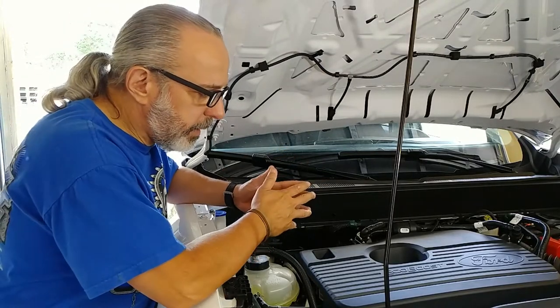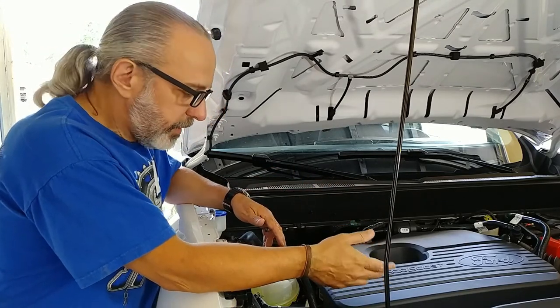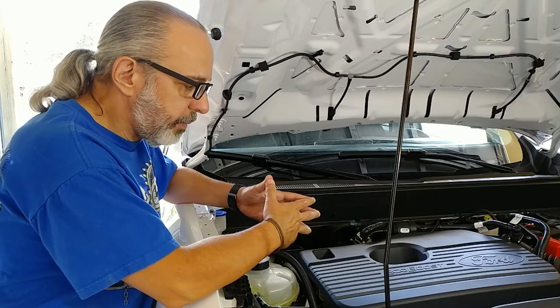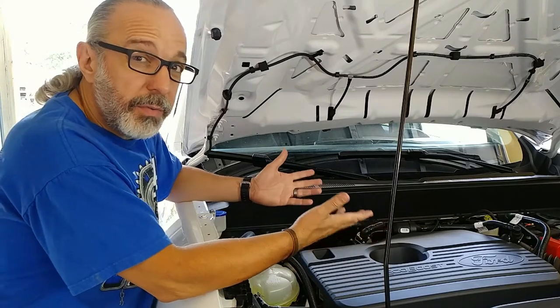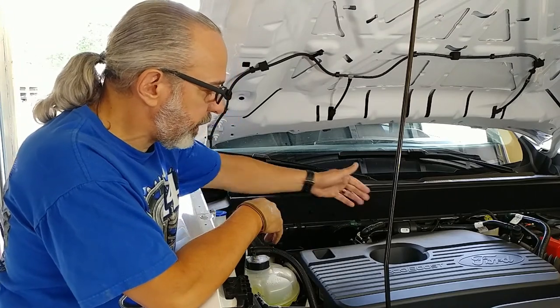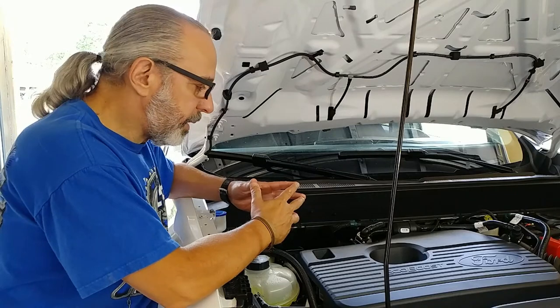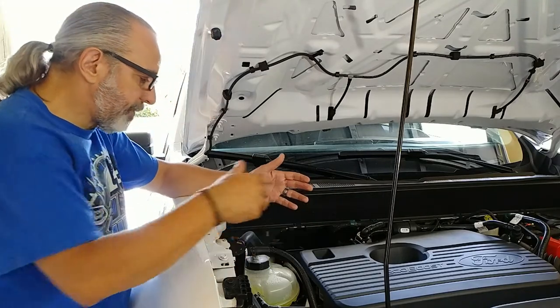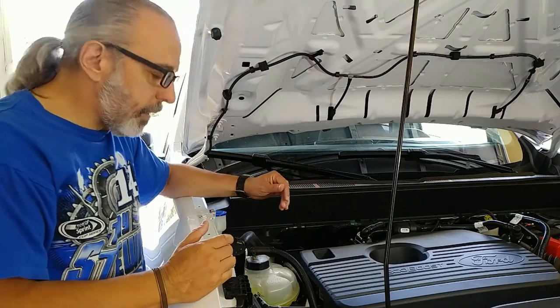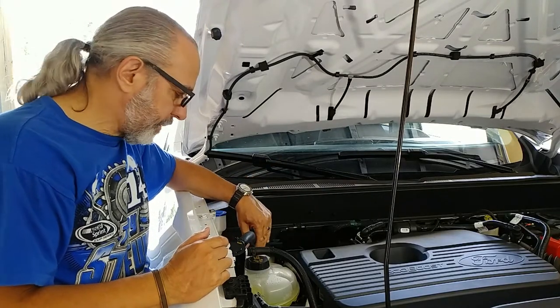As expected, the vacuum on the manifold side, on the bottom side by the PCV valve, which is, I don't know, 150, 200 times more than the one on the valve cover generated by the inlet tube, started to be an issue. When you drive the vehicle 20, 30 miles, I found that this tube is starting to get flat, collapsing.